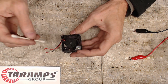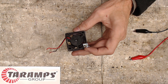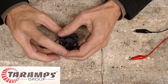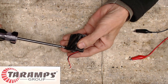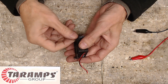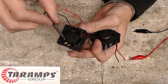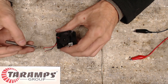Once you get the isopropyl alcohol up underneath, that sticker will slide right off. What you have is a hole right in the middle where you can see the shaft end and the retainer of the rotor. It's really simple — peel the sticker off. Now, the fan's not going anywhere with that retainer bar in there. In my videos when you hear me say it just needs some fan work, this is what I do — take the fan out. This one here has several broken blades, but the stator is still good, so I keep that and ditch the fan blade section.